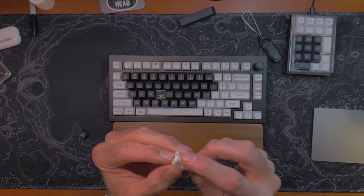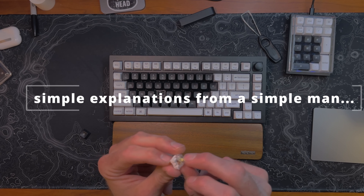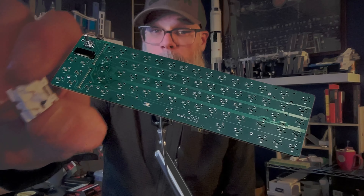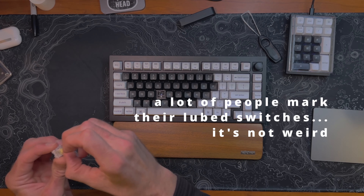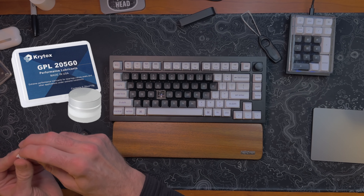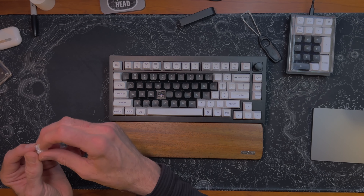There's three parts. You can see this yellow peg-looking piece, and inside there's a spring. Pushing on that yellow peg sends the signal down to these little metal pins, which are connected to the PCB, and that sends the signal to your computer. I've got some Sharpie marker on the bottom of this switch because I lubed it. When you lube your switches, you take them apart and apply a machine lubricant wherever there's plastic-to-plastic or plastic-to-metal friction, which provides a much smoother feel and less scratchy sound.